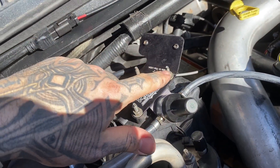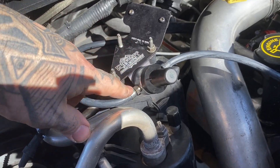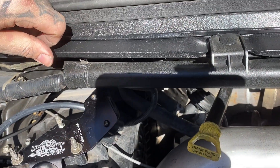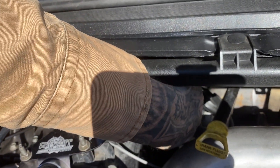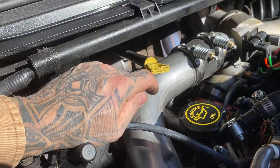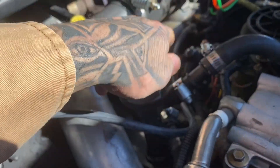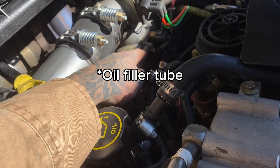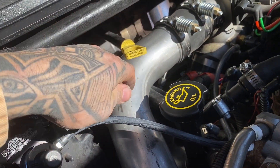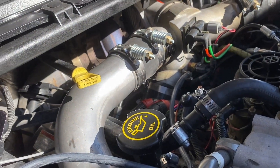So just a quick recap: we've got both of our clamps on those, we're going to find a third one — I forget the size. We got this side just coming around like that, and hopefully it's picking up on camera. Just push the MAP sensor wire out of the way so it doesn't touch the cold side of the charge pipe. And I decided to run the hose in front of the dipstick and just have it come out right here, instead of running it on top or underneath, because if it was still pulling up and touching, it might be okay even if it touches, but just to be on the safe side. So that's pretty much it.